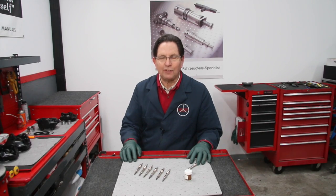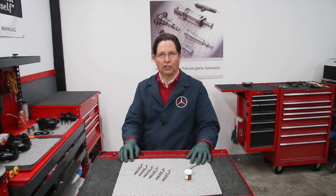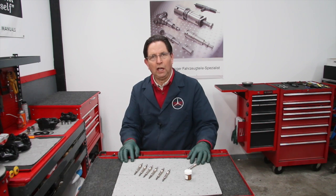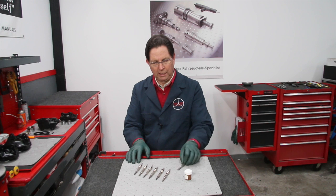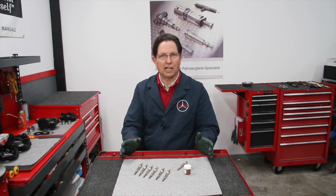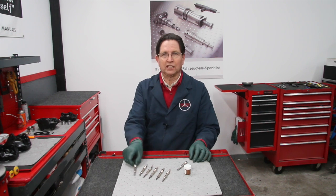If you own or plan to purchase a 1995 to 1999 Mercedes E300 diesel, this is a video alert. I want to talk specifically about the glow plugs in these engines. They're quite different from the glow plugs in the earlier diesel engines like the OM617, OM602, 603, etc. What I've got here on the bench is a set of the glow plugs and a custom carbon reamer that we make right here in our own shop, and a little tube of anti-seize, which I'll explain later. The issue I want to address is the glow plug seizing in the cylinder head.